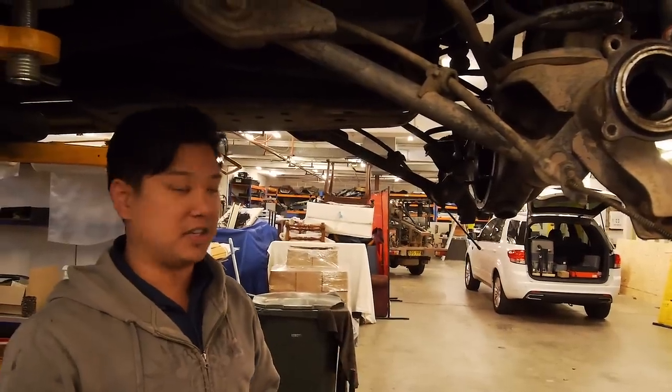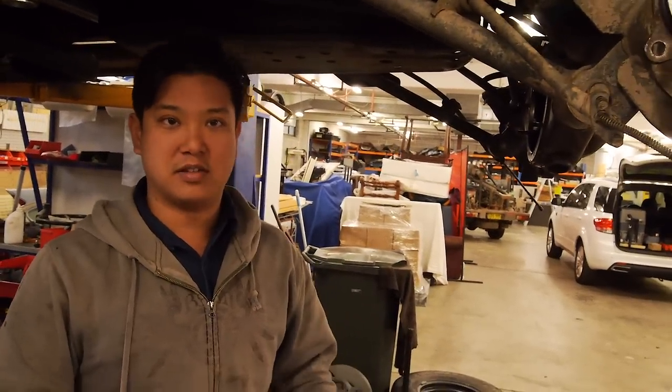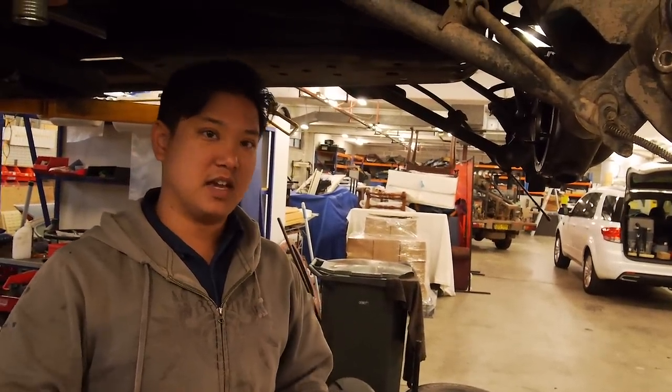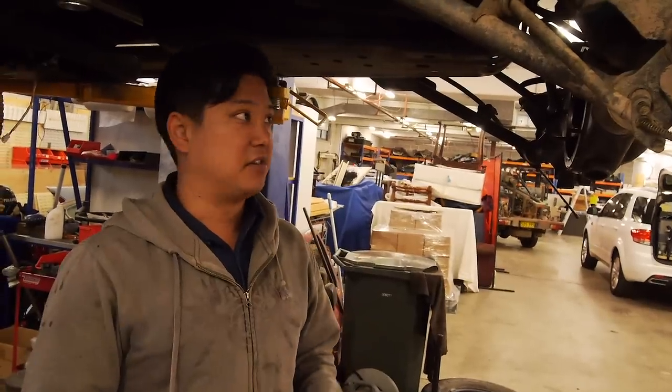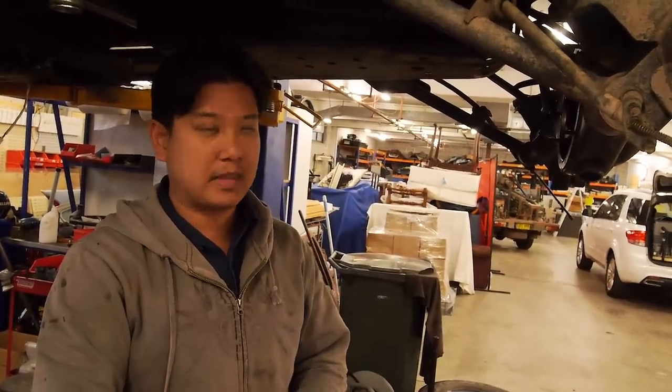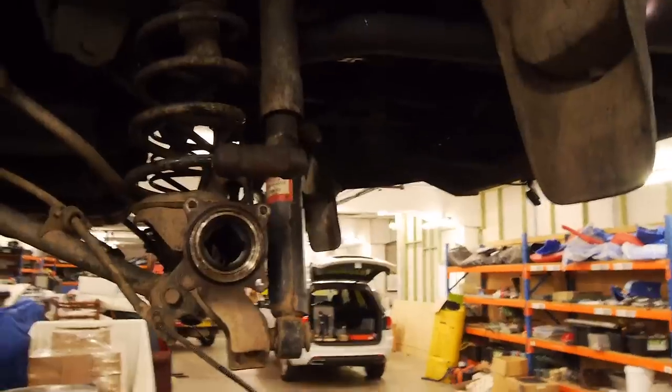And the counter bores and everything else. So the good news is you have the best diff pumpkin, in terms of upgraded bearings and bigger sizes and all that. The downside is we can't do anything today because we need to order new bearings, we need to order new ring gear, etc. It's a shame they didn't swap the whole rear axle and give me disc brakes on the rear from the Prado as well.